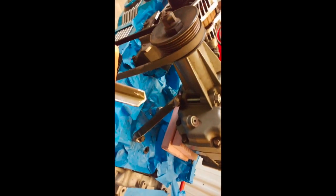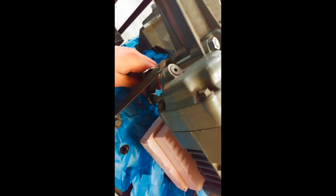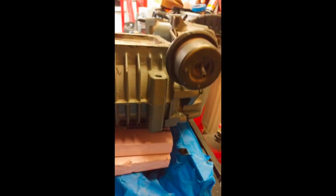At the moment I'm fabbing up some mounts for the supercharger. You can see our first one here — these are just made out of some angle iron and some nuts that I used for collars. This second one is going to get welded in down there, tacked and hammered, and wrap around. Then we're going to do a third one off of the hole here — that will come up, we'll have a little teepee. I've also got a mount back here and a mount on this side. They're going to be a little bit more tricky, but I'm going to make a similar stand for the other two points and then tie this all together.